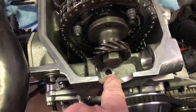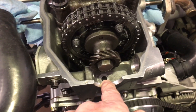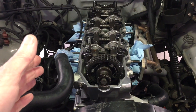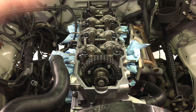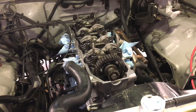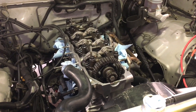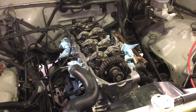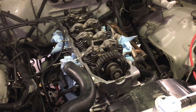Don't forget about that little nut down there — more than one guy has unbolted his cylinder head, yanked up with a pry bar, and forgot there's a little front bolt lurking in there. Anyway, that's where we're at with the 22RE. I'm going to do the final timing — I've done the rough timing on the cam, now I've got to adjust the valves today, do the final cam timing, get the oil pan back together, and we'll be firing up the motor in no time. As always, the comment section is open if you have any questions. Hope you've enjoyed the video — thanks for watching.